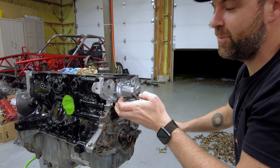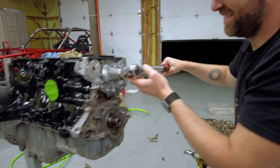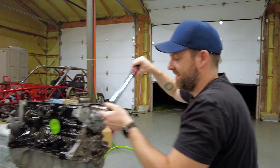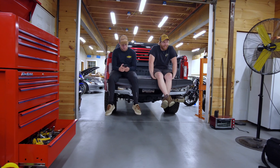You know what we have to talk about? Tires. Matthew wants gigantic tires. They're not gigantic — they're OEM size on a Jeep Wrangler 4-cylinder. That's gigantor. That's 215/75-15s. I think we should do 215/60-ish 15 tires. The gearing gets extended quite a bit with tires that size, but that's why I want to stick to more normal. I think it's going to be more super moto concept with the rally suspension. It's not a super moto. This is going to be a super moto.